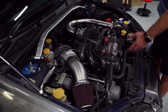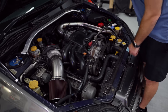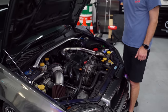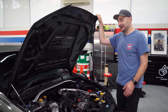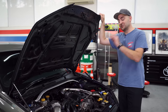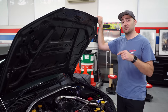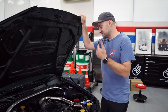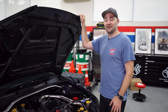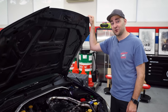It's got dual AVCS, it's got it on the exhaust and the intake cam. It's got a big Garrett turbo there. And to keep it all in one piece, it does run ethanol plus some big injectors and some Haltech management with an Elite 2500. Ethanol is keeping this engine alive. This is knock limited. If you put petrol in it, you make basically no power because it will just detonate and that will kill the engine. Ethanol makes it run cooler, keeps more fuel volume, gets the turbo spooling up. It only runs between 8 and 10 pounds of boost and makes 300 kilowatts or 400 horsepower.